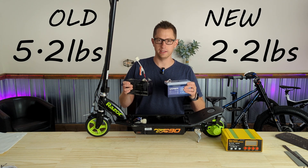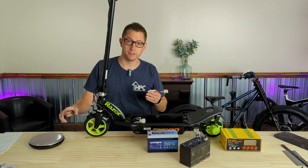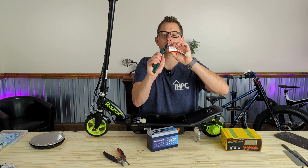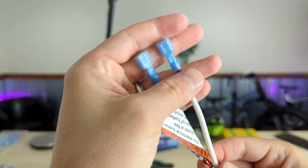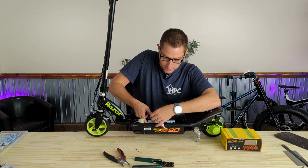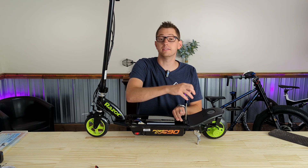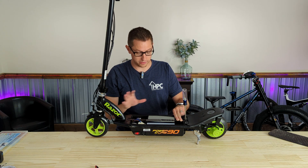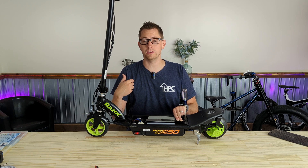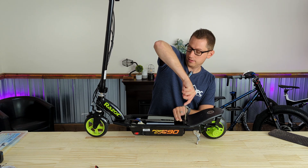One thing we need to do is cut the connector off the old battery and put new connections onto this new one. I'll include a link to this battery in the description if you want to replace yours with the same or a similar one. Reconnect the connector. I think nine times out of ten when you do one of these repairs, it's going to be the battery. It is possible that it's the motor in the back that's blown, or the speed controller that sits between the two. If you replace the battery and it still doesn't work, you can test the voltages going to the motor and even coming from the motor if you spin it manually — back up the two leads across the bottom of this plate. With your multimeter, you can figure out which side of the equation your problem's on.